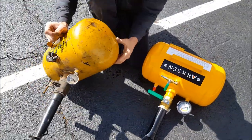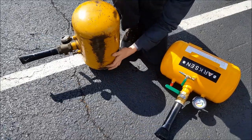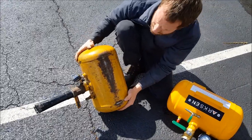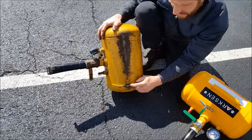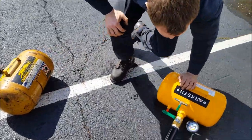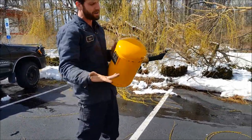One thing to note about these tanks — this Cheetah has some dents in it. When you get dents, it's a good idea to replace the tank, as it really affects structural integrity. This one's also due to be replaced because you can see it's starting to rub through the weld right here on the bottom from being on the shop floor and kicked around. Besides that, this knockoff seems like a well-worth product for $70.